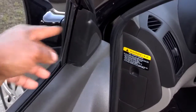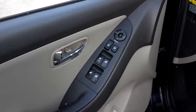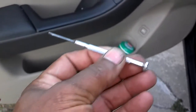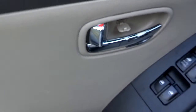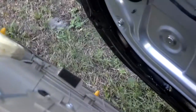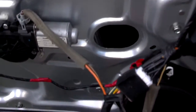On this vehicle, when we roll the window up, the window gets on the wrong side of the seal. So we're going to take the door panel off and figure out where down in that track the window got off, or replace it — hopefully it won't flip back out. First thing you do is take the small utility screwdriver, pop this cover up in the handle, pop that cover open, and take those two Phillips screws out. After those two screws are removed, you can put your hand in the lower panel and jerk it — along with this handle — and the clips will pop out of the door. You get several clips along the edge of the door, then you need to unplug your electrical wires so you can set the door panel aside.